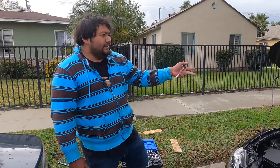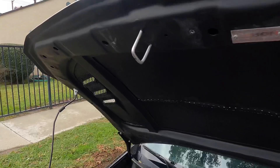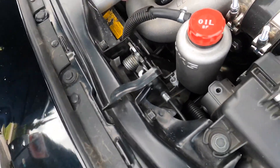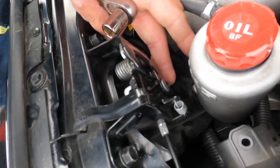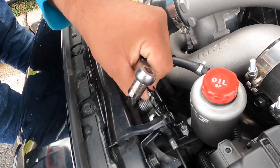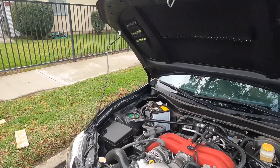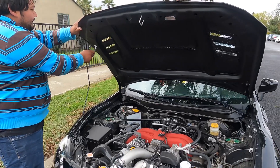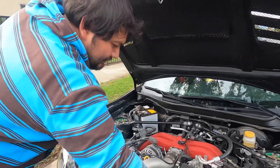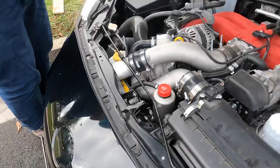Alright, so we got the hood installed — easy four bolts. I did have an issue with this, so we just had to adjust the latch. You gotta get in the back right here for this one, and if you're supercharged that's gonna be kind of hard to reach, but literally just lift up and that's it. There's two bolts here — we had to move the latch higher. I kind of want to put some foam right here just to stop this noise.